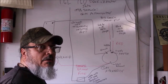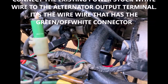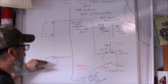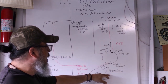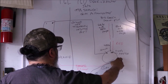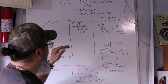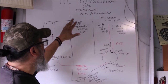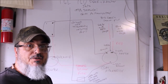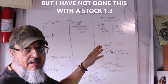Hopefully you can see this diagram. Pretty self-explanatory: we got a battery, we got a starter, and we got the GM alternator. We also have the supply adapter that comes with the GM alternator in order for you to connect to the stock wiring in your Samurai. This only works for the 1.6-liter 16-valve Sidekick engine upgrade that you're putting into a Samurai — it's not going to work for the 1.3.